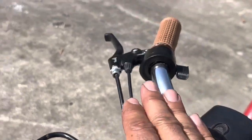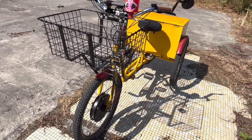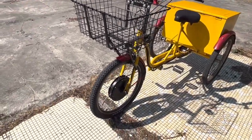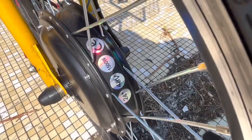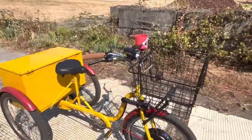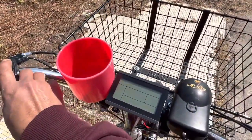That's running through the brake cutoff switch of the fairly random front wheel motor kit I also found used online locally. Picked it up from a guy with the battery — a 24-inch front wheel. This is a 1500-watt front wheel kit, at least as far as what it says it's rated for. When you look at the controller, it's like a 35-amp peak controller, plus or minus 1 to 2 amps, so we're seeing on the display numbers as high as 1600 watts or so.